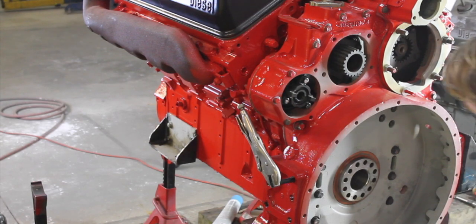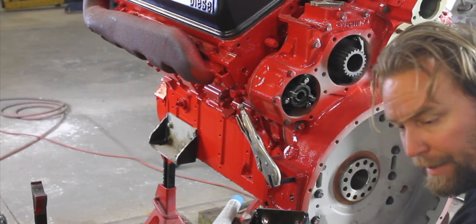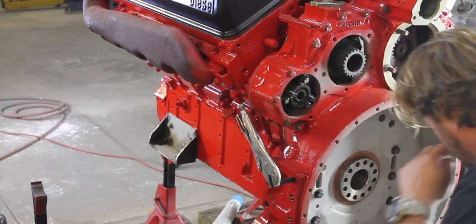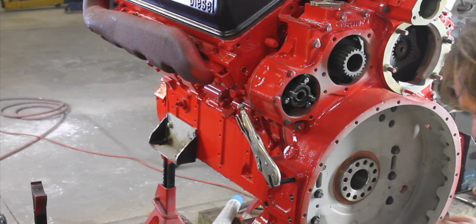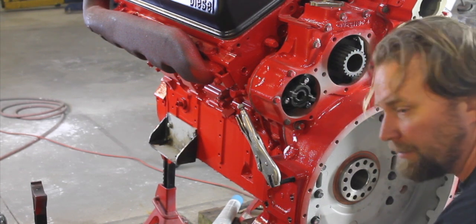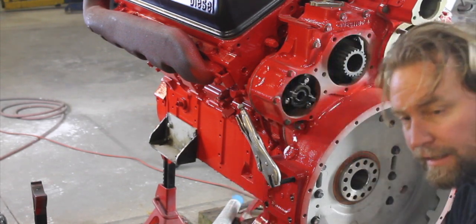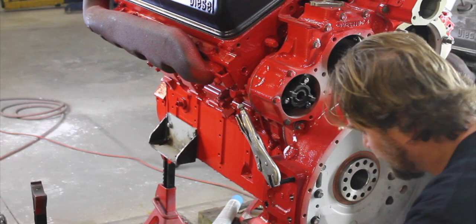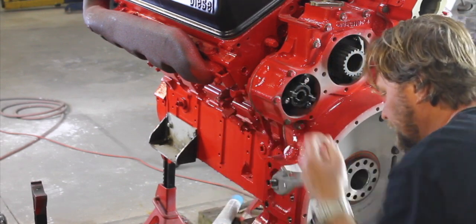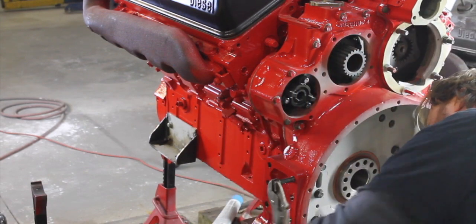I put these motor mounts on, that bolt to the bell housing here, and I started running the bolts in, and it was starting to bind, or they were crapping the threads, so I'm literally just chasing out the threads now. It's a 5/8-11 tap, so luckily I have one. So I'm just gonna clean these out and then put them on permanent.